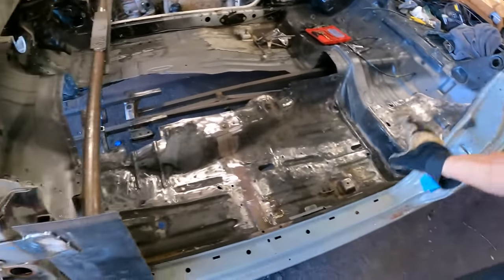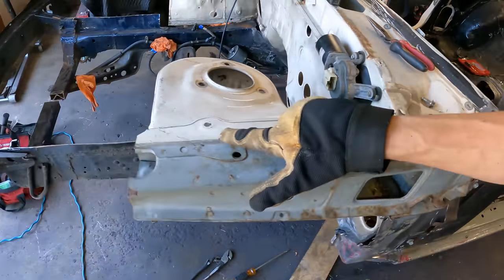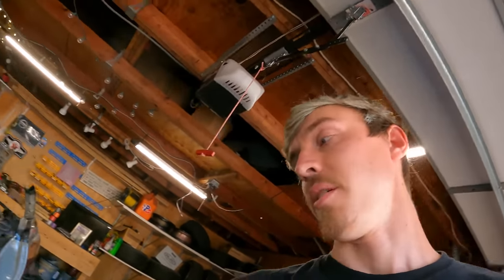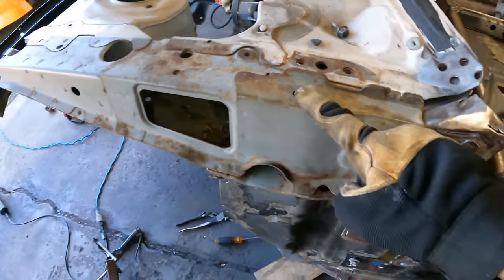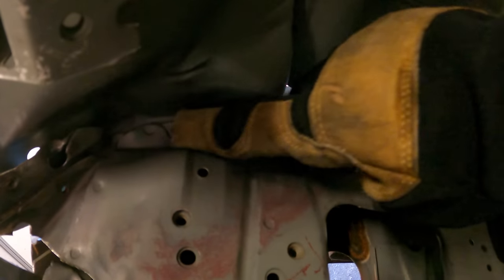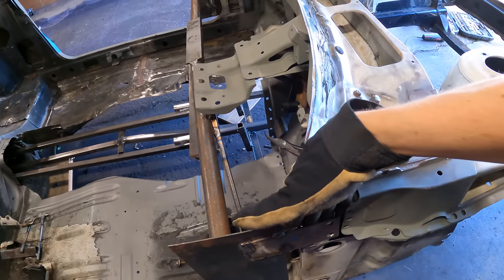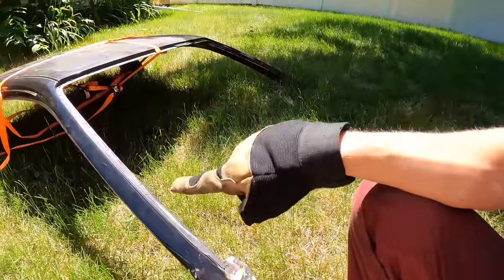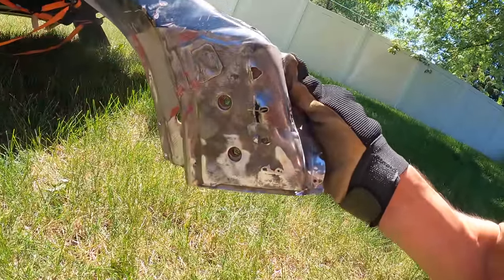So far we have the half-cut on the car, the jig roughly mounted but not tightened, and the firewall with the shock towers. I'm thinking of taking off this little panel because I won't be able to fully weld in the corner piece. For the other side it's going to be really hard to drop in the roof and squeeze into that section. If you guys remember, when I prepped the roof I left the top two door bolts attached to the A-pillar — that's how it's supposed to be — and then the jig will help align those two bolts.